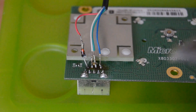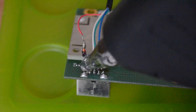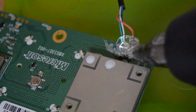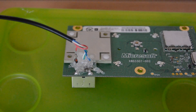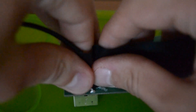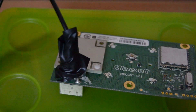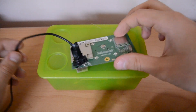After you have successfully soldered those points, recheck them to make sure you don't have any soldering bridges that could short out the USB port. Then I recommend using some hot glue to fix the soldering points — just add some hot glue and they will stay in place, and it can also be easily removed. You can also use some additional isolation tape to insulate the soldering joints — just wrap it around. Then take a wire strap and put it over the isolation tape so it won't come off, and then it should be well protected.